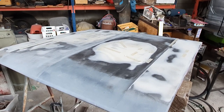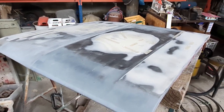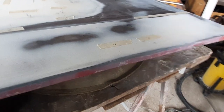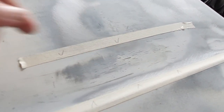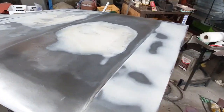There's nothing more frustrating than doing what you think is the last skim of filler and then getting to the end and realizing you've missed some and having to mix up and do yet another last one. So I'm at a stage now where I've marked all the little pinholes and nicks - there's a big one there, a ledge there that looks like an adhesion problem, a tiny little bit of roughness in there. The primer would probably take care of that, but that's not good. In here, this is where I tried to wipe some filler that had already kicked.